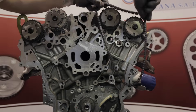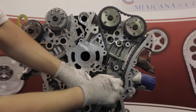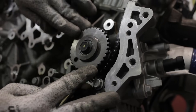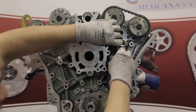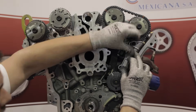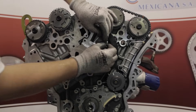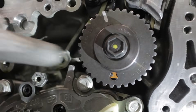We will start the assembly with the left bank secondary drive system. Install the left bank camshaft drive chain along with the intermediate drive chain idler. Align the similarly marked links of the chain to the L timing marks of the VVT cam sprockets, and the unique marked chain link will align with the hole on the intermediate idler. Torque the idler bolt to 43 foot-pounds. Install the left bank tensioner guide and torque the bolts to 18 foot-pounds. Next install the chain guide and torque the bolts to 18 foot-pounds. Install the left bank secondary tensioner and torque the attachment bolts to 18 foot-pounds. Recheck the timing alignment and pull the pin to activate.